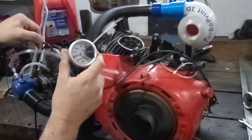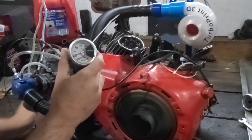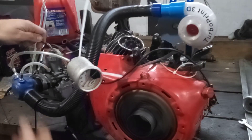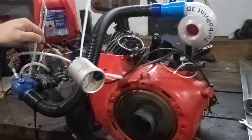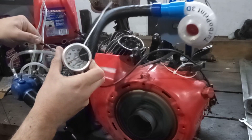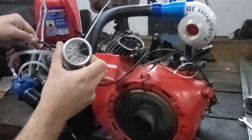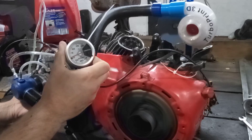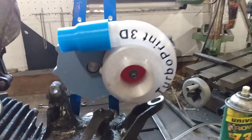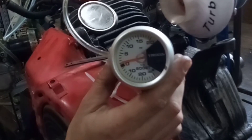This leads me to needing a little more gearing. Understanding the ballpark size of this turbine housing, I'm going to need approximately 25,000 RPM to hit maybe 5 PSI on an engine like this — though these are rough estimations. I do have another gear set that fits inside the original gearbox with minimal modifications, getting me about 4-to-1, with room for a larger pulley. The real issue is that at this point it kind of scares me — there's a fair amount of plastic spinning very fast, kept only by two bearings in the middle. It could easily explode and shoot out the front or side. Any faster than this and I suspect I'm really in the danger zone.